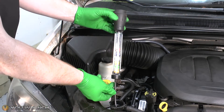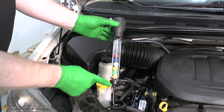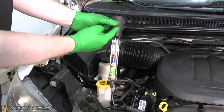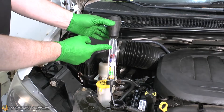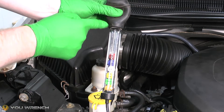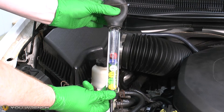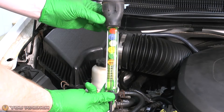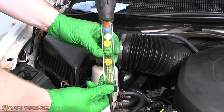Now we take our tube, push it down into the radiator, and then squeeze the top. We should hear air going in, which tells us we're definitely in the coolant. Then when I release the squeeze on the top, that will start to draw the coolant up into the tube. So giving it a squeeze, we should hear some bubbling down in the radiator, and as I let go of the grip it will draw the fluid in — there it goes. What you can see has happened straight away is all six discs came straight to the top, so we actually need to let a little bit of air in.